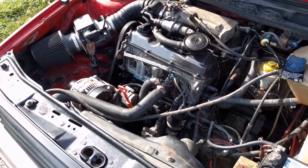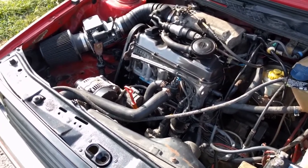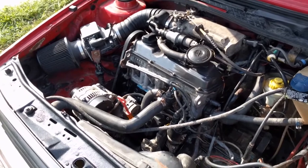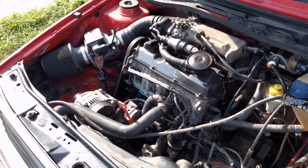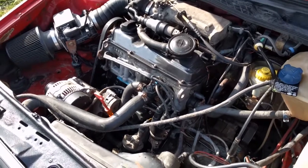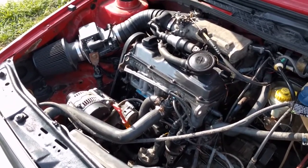They run them hard, 25 to 30 miles of slow it down and then punch it, run it through the gears. Obviously you've got to stay within legal limits, so if you can find an open highway where you're not going to annoy anybody for constantly slowing way down, keep it under the speed limit, keep it safe, try to do your break-in where nobody's at. If you have access to an old abandoned runway, then by all means, that is an awesome place to do it. But it's hard throttle, go through the gears, slow it down.